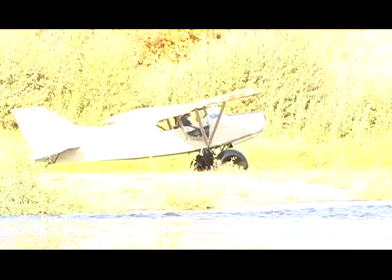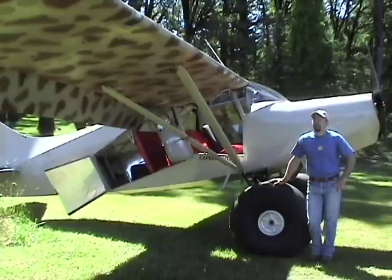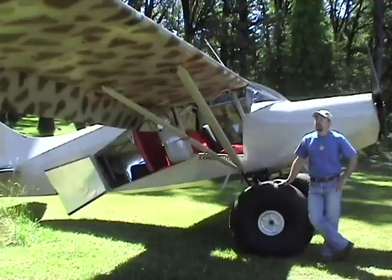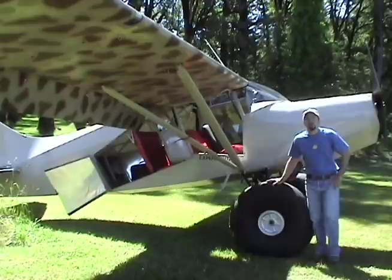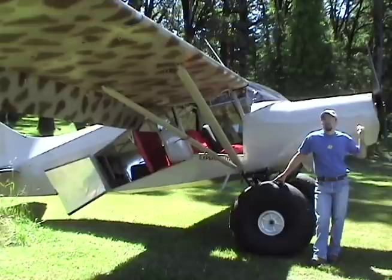If you've made it this far through the video, the next segment is a short segment I did on Bushwhacker when I had finished it for the first video of Big Rocks Long Props Volume 1. Bushwhacker was conceived after flying an M5 for a number of years and wanting more performance than I was getting from my M5. So I came up with this design: it's an M5 fuselage with an M7 wing, sporting the large flap — 126 inches of flap. It has an extensive list of modifications, starting with an O-360 engine with 10-to-1 pistons and a custom exhaust, running a 90-inch fixed-pitch prop pitched at 32.